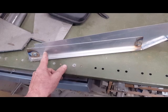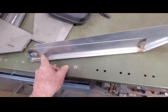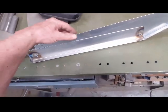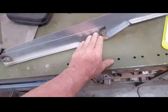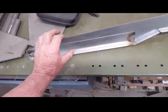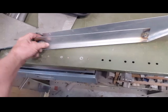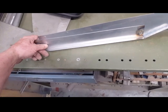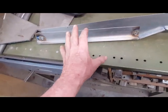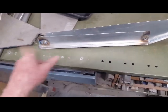I'm going to drill about an inch away on either side — two more holes. Those two holes will have studs that go through slotted holes in the tray itself, and the studs will be welded to this piece. That way this piece will be able to be moved up and down and slightly forward or backward, and you'll be able to tilt it, then reach up from the back side and tighten some lock nuts on the back side of the tray to keep the window in adjustment.